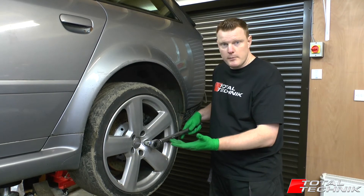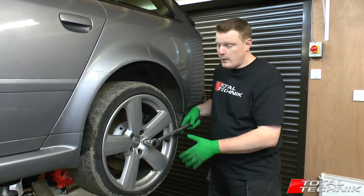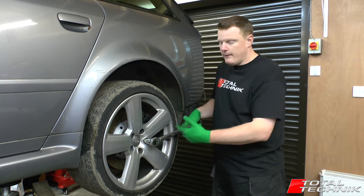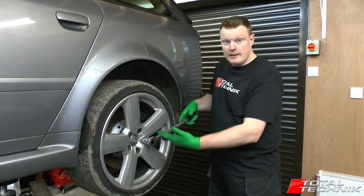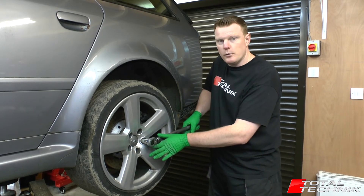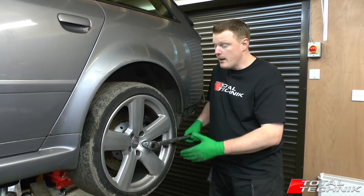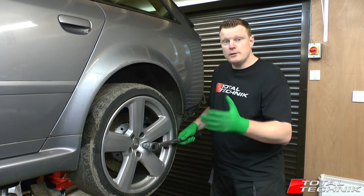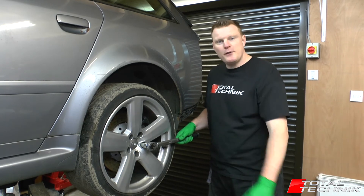What you'll find most often happens in garages or workshops is they'll set the torque wrench to 120 Nm, torque up the four wheel nuts as usual, and then very often they won't reset the torque wrench again — unless it's an electric one and it's easy to do. They'll just put it onto the locking wheel nut, get it so it clicks at 120, and then give it a bit of an extra turn on top. So that's 120 Nm (89 ft-lbs) for the standard ones, and 140 Nm (103 ft-lbs) for your locking nuts. Best of luck with that and I'll see you on the next video.